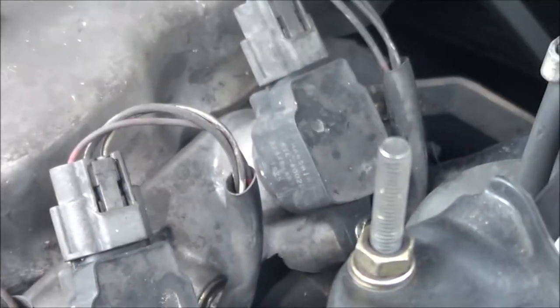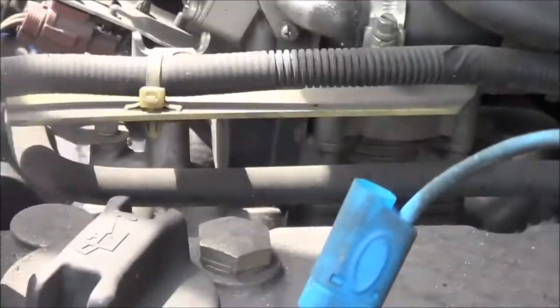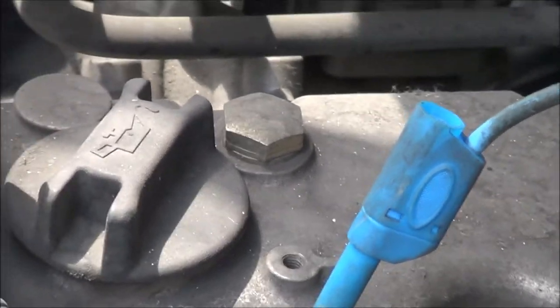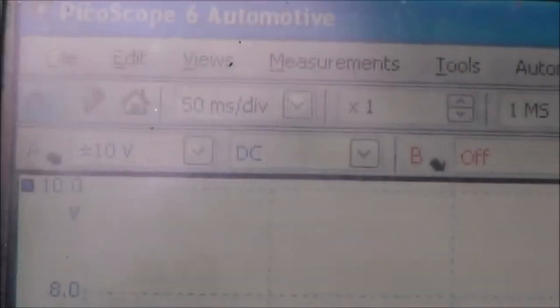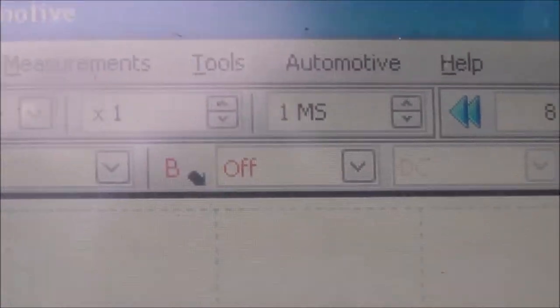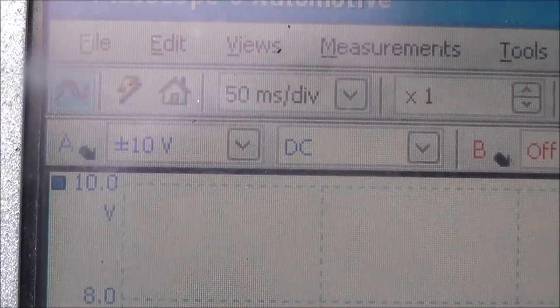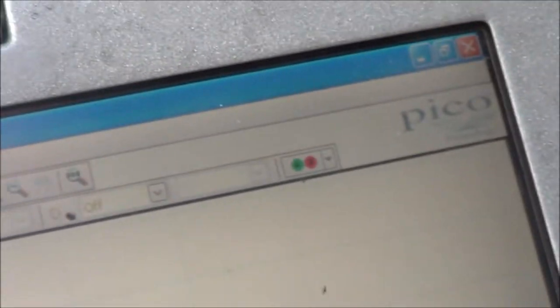So next steps, I'm going to try to look for a control signal on that coil. Right now I have my channel one hooked up to my good coil. So I'm going to be looking at the control signal. Setup for this is channel A, 50 milliseconds per division and 10 volts. Okay, so let's start it and see what we see on that coil.